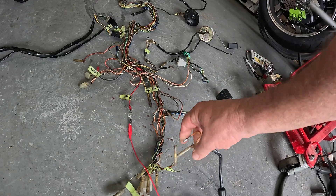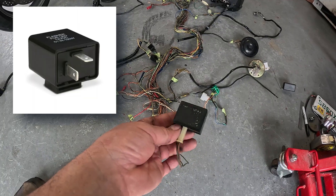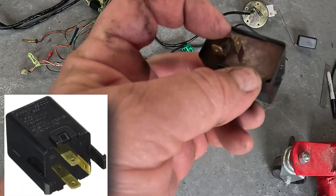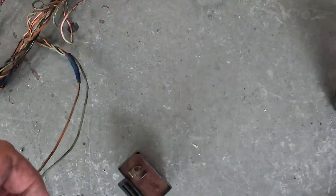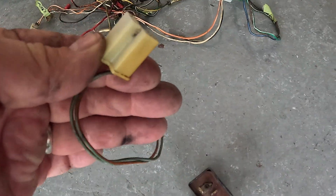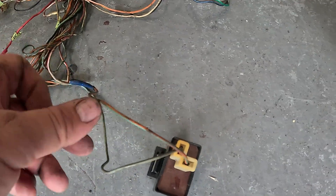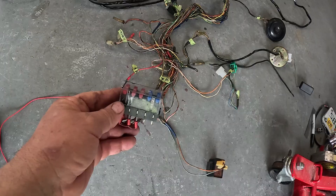It's a really good deal to find a bike with a good wiring harness that hasn't been molested. On your wiring harness you're going to come across a box — it might be round or smaller — but it'll have offset-looking prongs, either three-prong or two-prong. That's your flasher. It may not work with LED lights, but that's okay — you just get an LED flasher. These wires go from your power source, turn into a flashing signal, go to your switch, and are used for your blinkers.